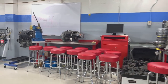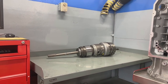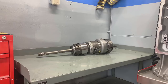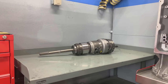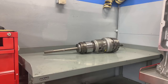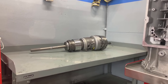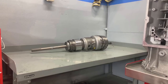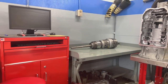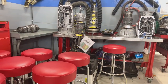If we come over here and look over on the far table, that is the gear stack up from a Chrysler 48RE automatic transmission. It's an old 3-speed transmission in the front with an overdrive unit stuck in the back to make it a 4-speed. The pieces in the front there that look like they're wrapping around the shiny silver pieces are called bands. Instead of clutch packs stopping those pieces from rotating, they use bands to stop those pieces.